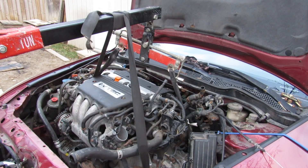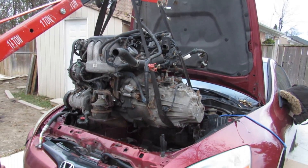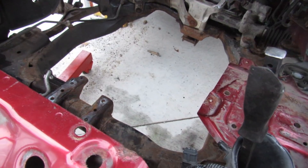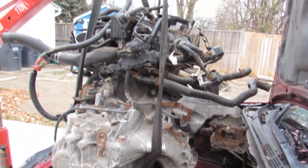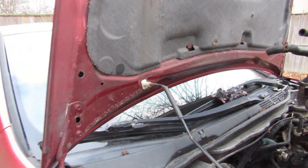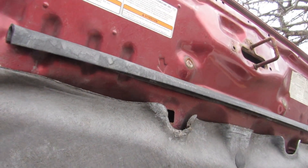With it all strapped up I'm going to lift up this engine. Here we have it — the engine and transmission lifted up off of the subframe down below. You can see everything is disconnected and we're clear to lift right up and take it out. One thing I really like is that Honda gives you an extra hole over here so that you can make the hood almost vertical when taking out the engine. The original hole is up here if you're just checking your oil.